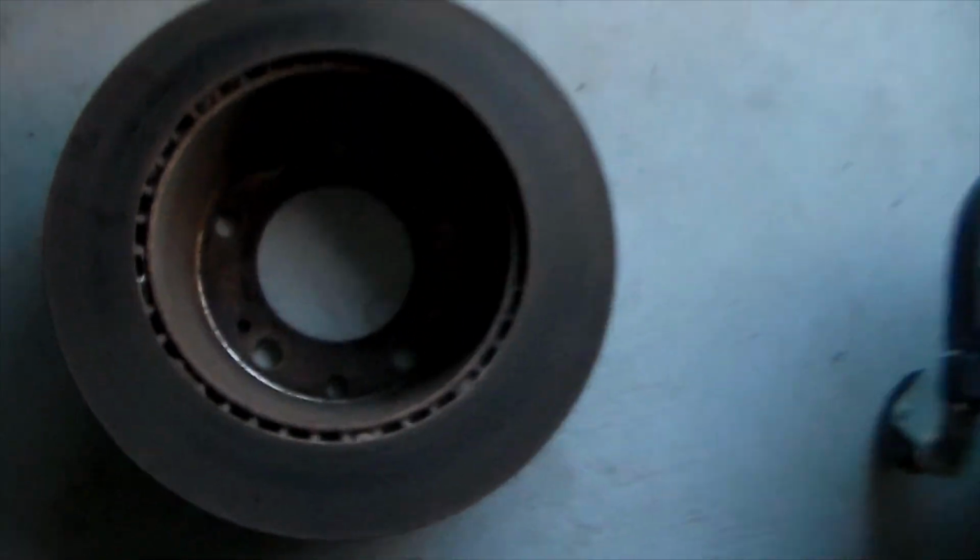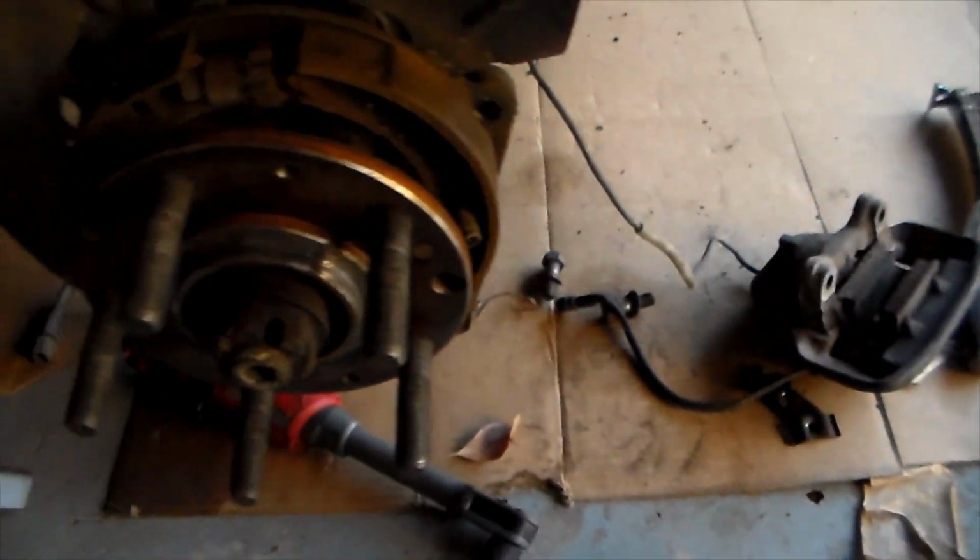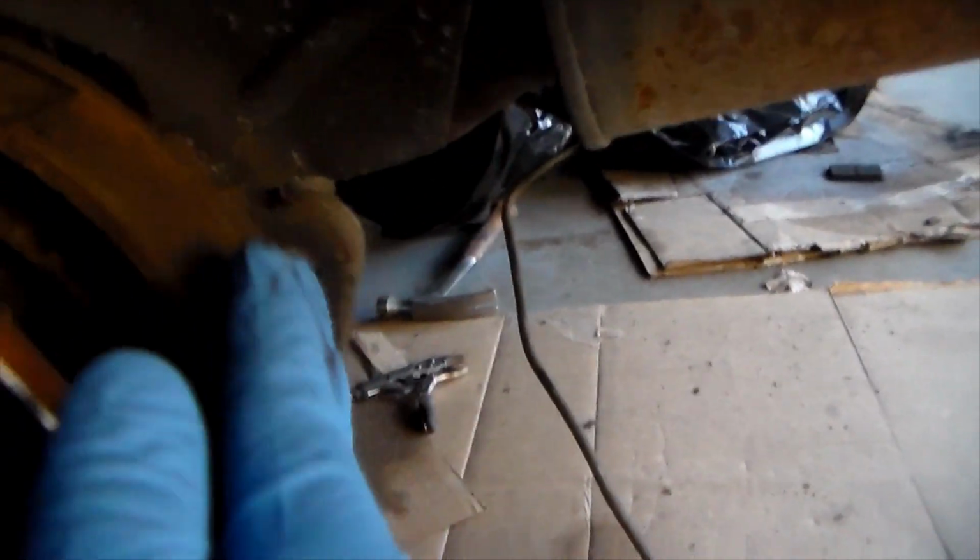And there it is. Looks pretty rusted. Definitely time for it to go. Now, this rotor is a drum and shoe construction, so there is a brake shoe on here. This isn't used for stopping though. This is only for parking brake application. They are adjustable, which is pretty cool. That's pretty much every car that has a drum and shoe assembly.